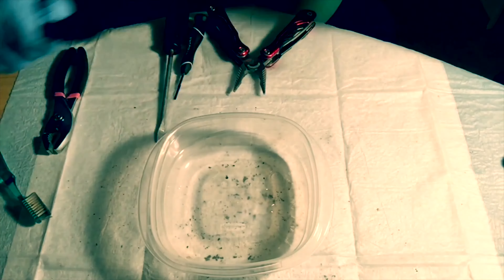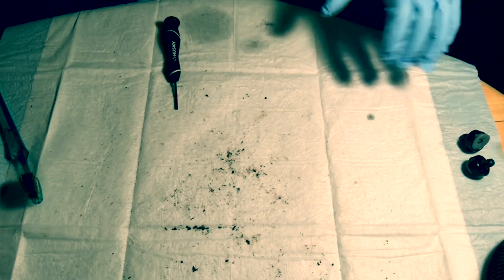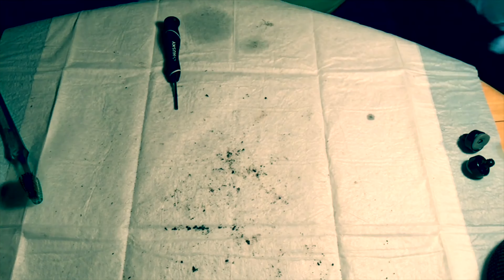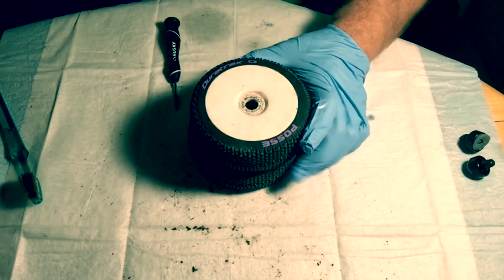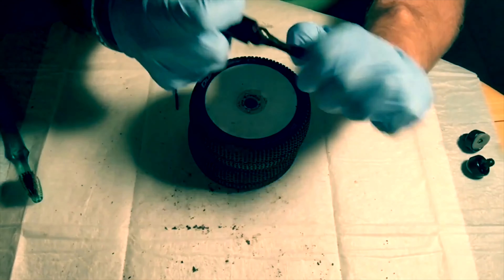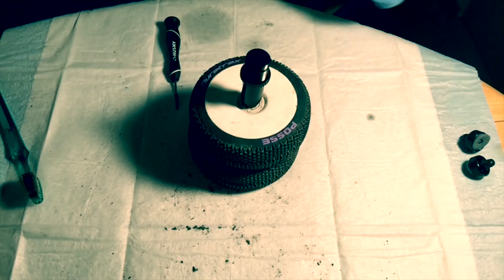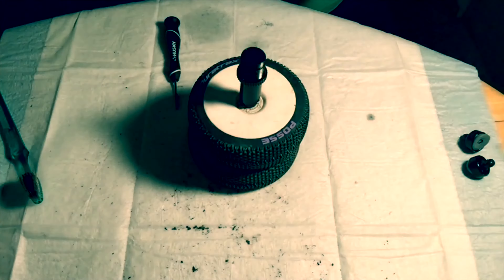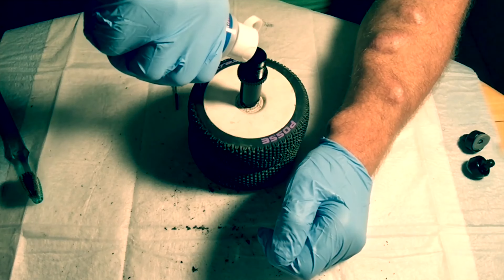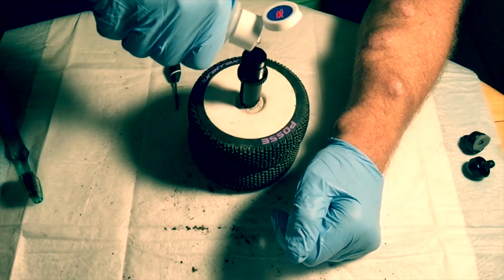So the final part is coming up — we're going to be filling the shocks. Here's a side note: it's kind of funny that stores sell these fancy shock holders, but when you take your back tires off to do your shocks, you've already solved your own problem. Take the tires you removed, line them up on top of each other, take your shock, make sure it's completely fully extended as far as the piston can come out, drop it ever so slightly, and set it right there. You've got yourself a shock holder. Now take your oil — I'm going to be using the 70 weight here for the rear — and pour the fluid in, filling it about three quarters of the way. Just enough to get in there.